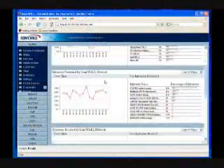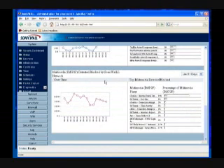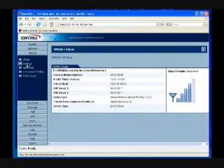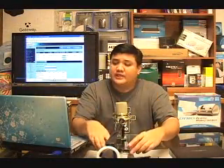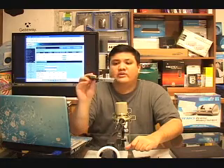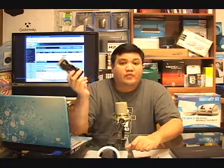About 30 episodes ago, we took a look at the SonicWall TZ-190. It was an all-in-one SOHO — small office, home office — appliance that really did everything you'd need on a network. It gave you DHCP services, NAT services, firewall, VPN, the works. The really cool thing about it was that it included a little slot on the back of the router which allowed you to plug in your 3G card, be it HSDPA or EVDO, from whatever vendor you might be renting service from.